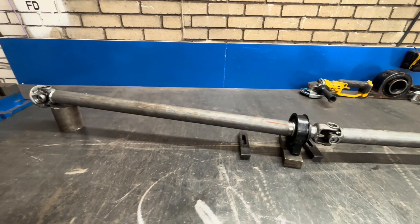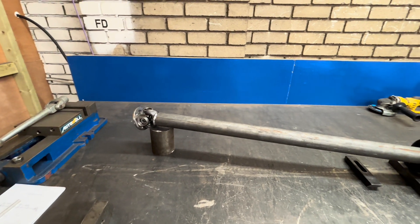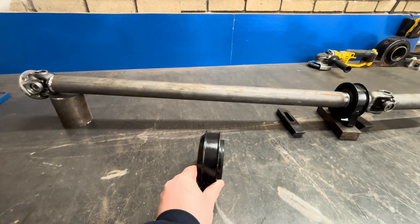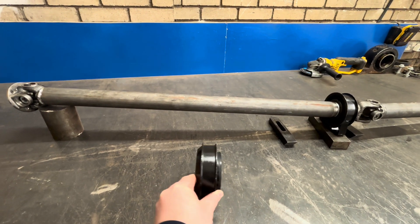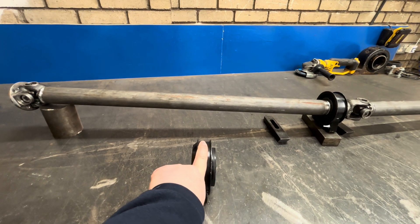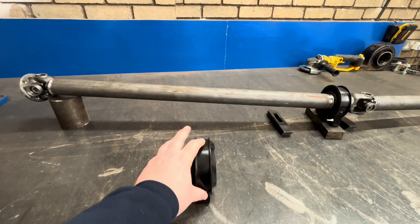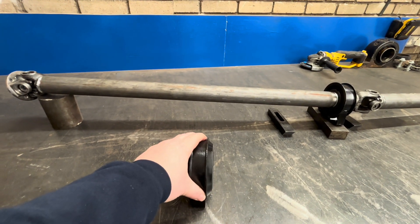Also, because this is running at an angle, universal joints don't run at constant velocity — they run in kind of an elliptical manner. So the center bearing, as this shaft is spinning, would be wanting to move around. We don't want that. This center bearing is just a holder — it's only there to extend the shaft and extend power. It's not universal. It does have a little bit of flex in it and can move a little bit, but at this sort of angle it will cause vibration. As soon as that starts moving, it causes vibration.